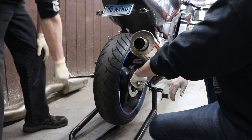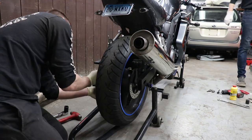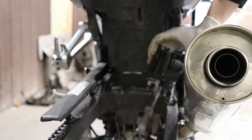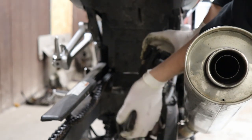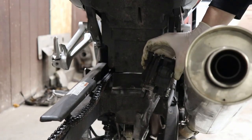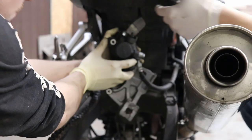Let's go — Ben will show me to show you how it's done. Similar to the front caliper: caliper here, pulled one bolt out and now it's hanging on its own bracket. This was being held in by the very large rear wheel bolt rod. I pulled the bolt out so we can make room to remove this, but once you have it off, this should slide right out.